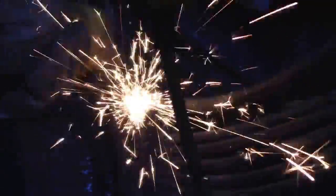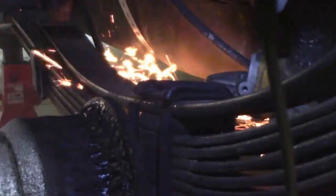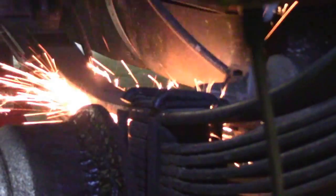This is how to remove u-bolts and the u-bolt plate. The easiest way to do it — since you shouldn't reuse u-bolts anyway because they're a stretch bolt design — is to just cut them with a cutoff wheel. They'll come right off and it's pretty straightforward.